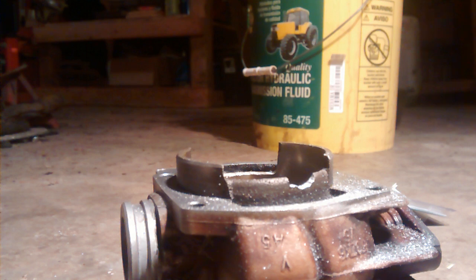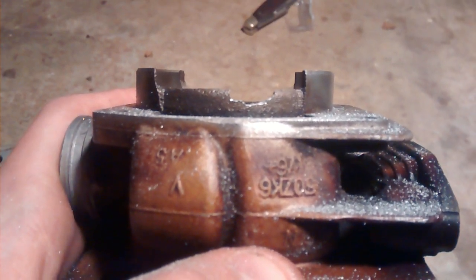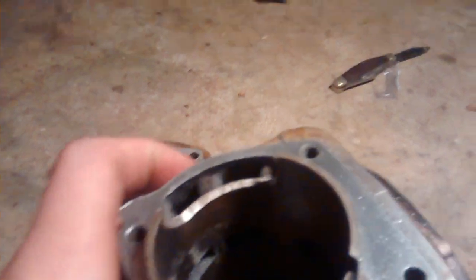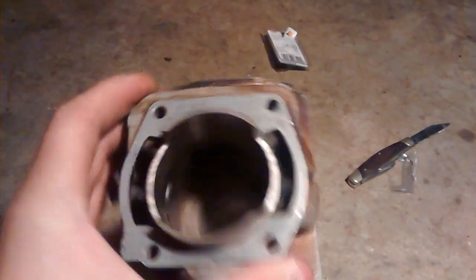You can see how I went down - it needs to go down probably another sixteenth of an inch or so, just right below the base. Don't go too far down, just nice and right below the base. Make sure when you're done to give it a good parts wash - run it in your parts washer, blow it out, and make sure it's really nice and clean. Like that finished one - I've washed it once and blown it out about three times, so it's nice and clean. That's how I do mine - thanks for watching.